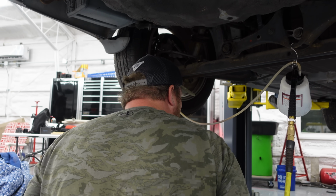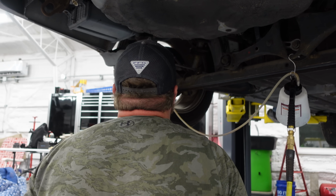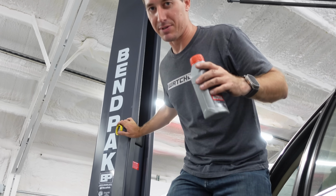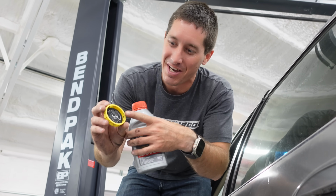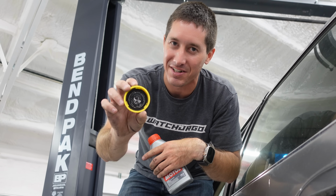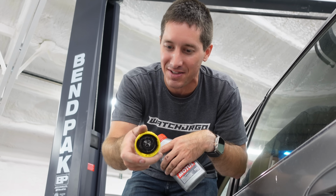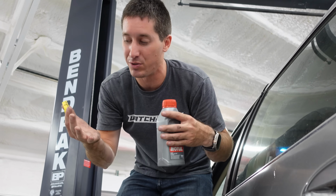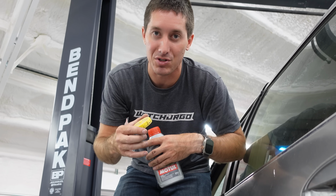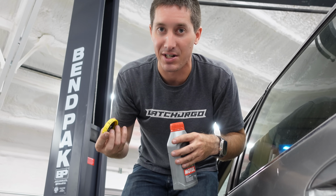Okay. I see a few little impurities in the line. You want to do it again then? Let's go one more. All right, I'm coming down, but take a look at this cap from the brake fluid. There is clearly some kind of condensation that turned into some salt left behind there. So I'm sure we helped this thing out a ton by just putting fresh fluid in it. That's probably what was causing the calipers to stick. So let's go drive it and make sure it doesn't lock up. We'll put a ton of miles on it, I guess.